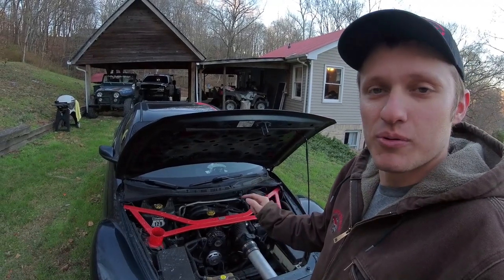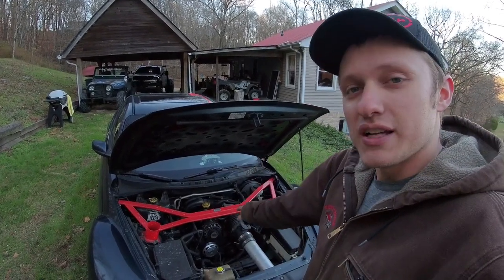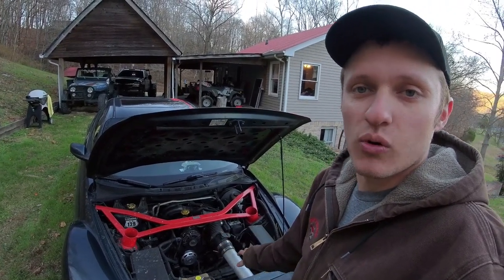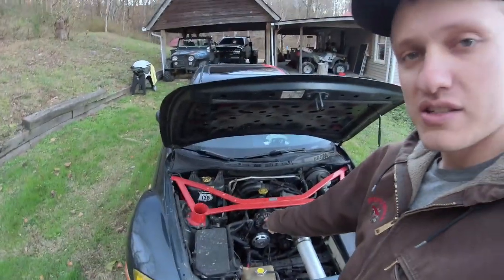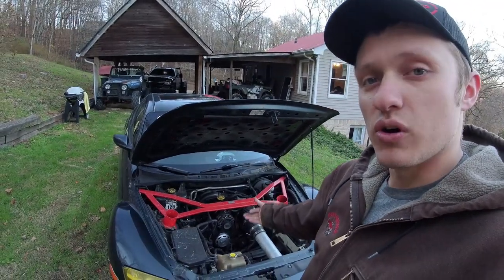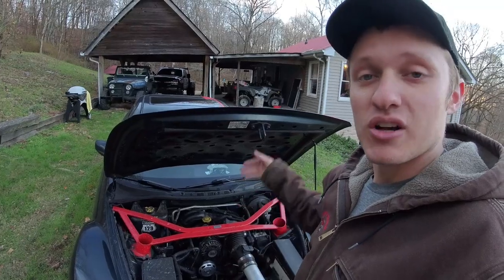Honestly, probably the most important thing that you should take away from this video is that wherever you take your RX-8 to get the oil changes done, you need to use conventional oil. Do not use synthetic oil. If you use synthetic oil, then you need to either install a Zone adapter on your car, which bypasses the oil metering pumps using the crankcase oil, or you need to block off the oil metering pump and premix only in your car.